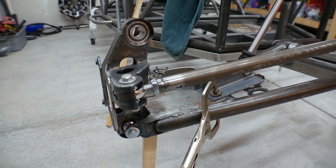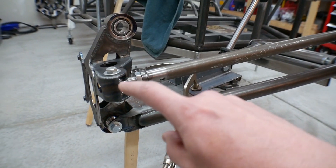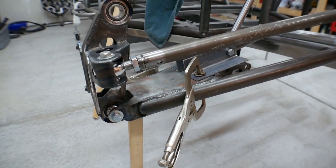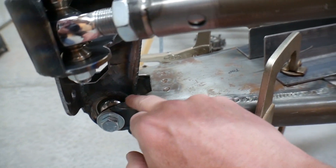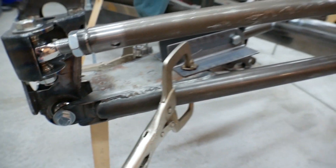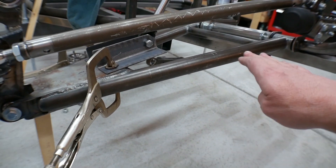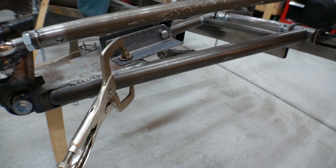I was kind of in between designs, but because they all had the same dimensions I could still move forward. Once I worked on the spindle and found the limitations of my steering — which is typically what limits my travel — I knew what my full droop and full compression was going to be. And once I had that, I cycled it and found out I can actually get enough articulation for the spindle, which brought me back to being able to use a straight lower control arm. That's a lot easier to make and gives me more ground clearance underneath the chassis.